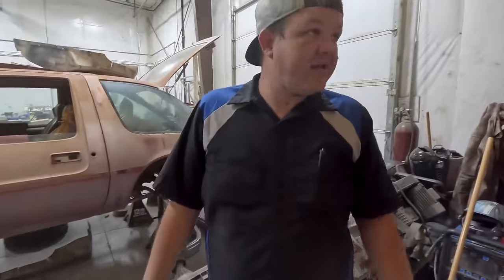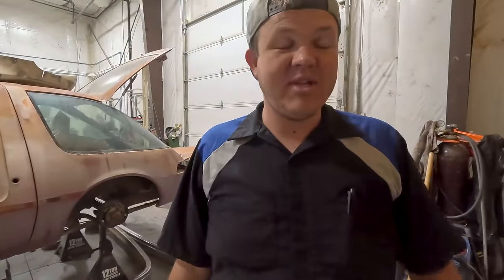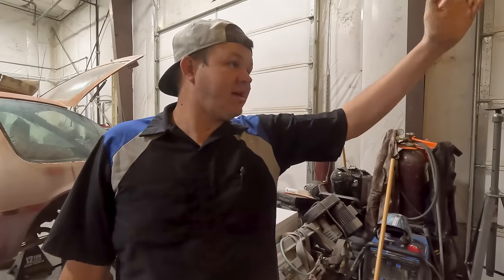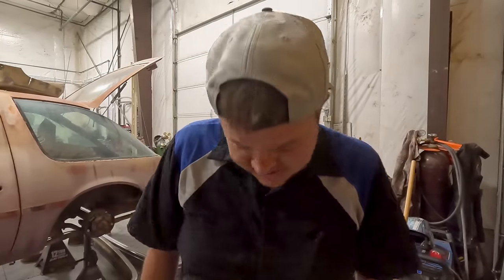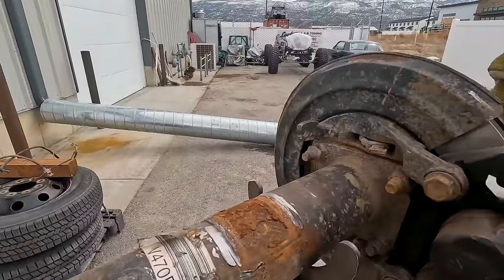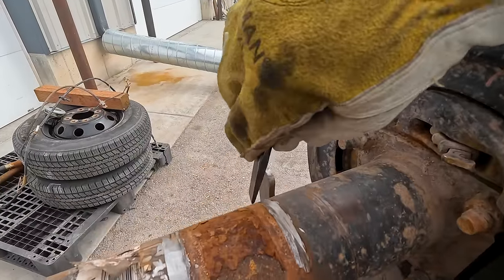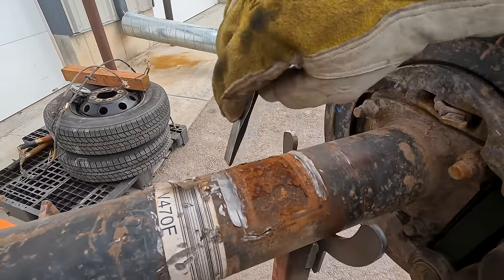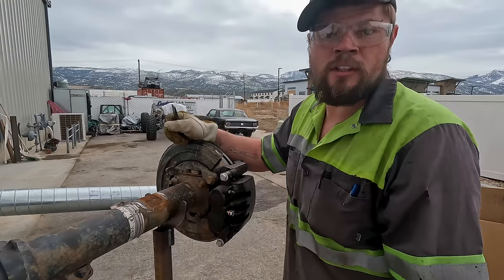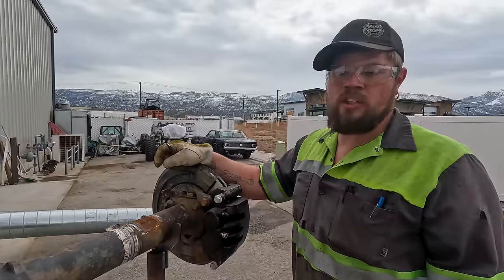All right, so what I gotta do now is swing this leaf spring into place, and then I'll use the stand, we'll hold it, we'll get the rear shackle, I'll get a rough measurement, then we'll drop it all back down out of the way and get some holes drilled. Now, let's see what it does. Oh, it's ground off. It's cut off. Got a little bit into the axle, we can just weld that up and fill that in, but one side down, one to go. I'll hang it off and show you guys the end result.